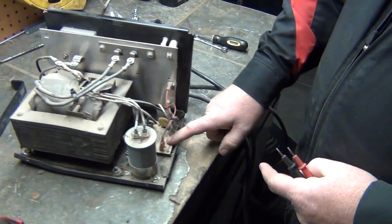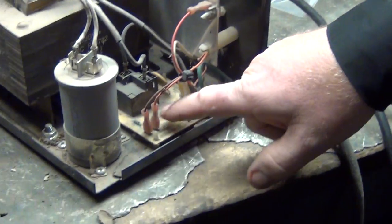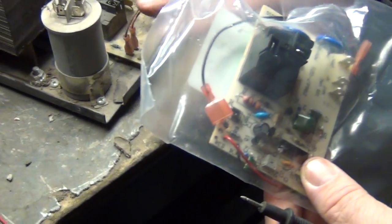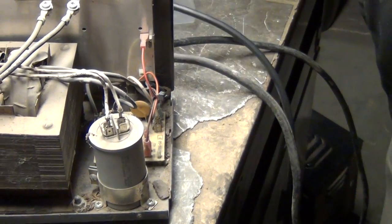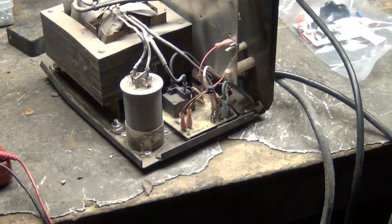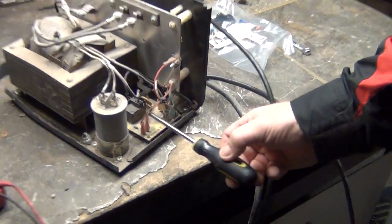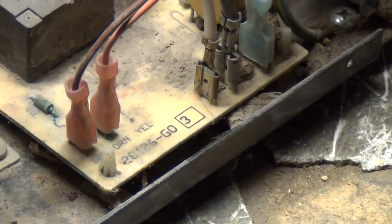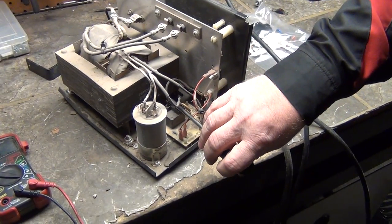The other thing we're going to look at is the board. This is an old style board — you have this board here and this board here. The new boards replace this board, so some of these wires you will not use. If you're not sure if the board's good or bad, just take a screwdriver, plug it back in, go between these two wires, and if she comes on, you know that board's bad. If the fuse is good and the diodes are good, and you do that, you know the board's bad.